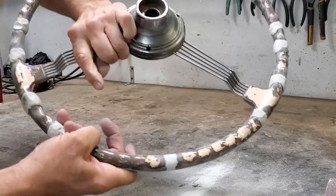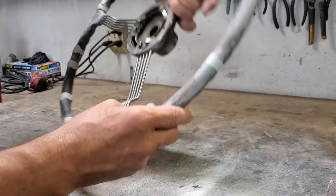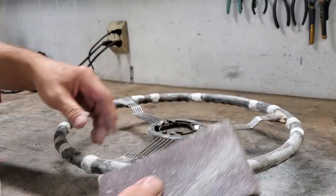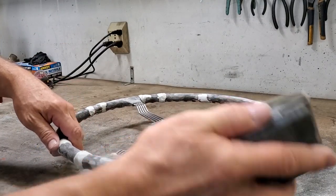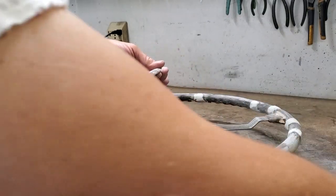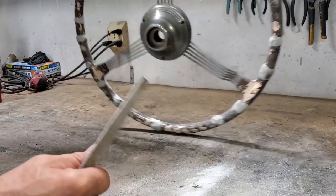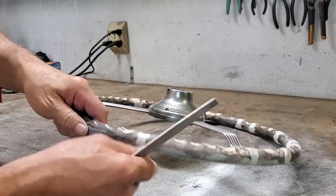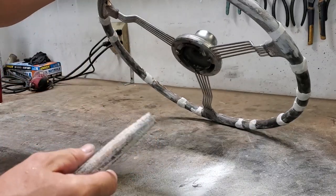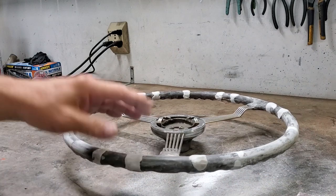If I turn it over, you can see we put the finger contour back in here and rough sanded it. How I'm doing that: 80 grit piece of sandpaper, this old scrap, in a hard block, also two different rasps, a small one and a large one. The rasp is particularly useful when you're going to put your contour back in for your finger grip on the back, because you can work it around and get everything the way you want to. Right now, I'd recommend the 80 grit sandpaper.